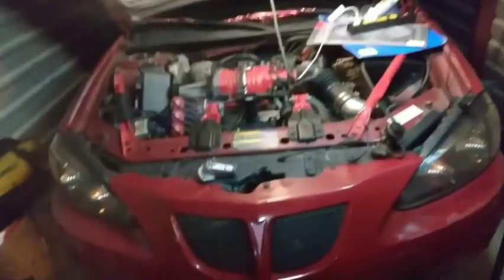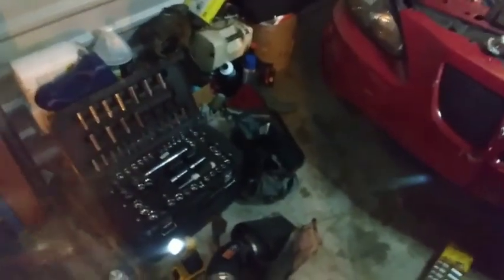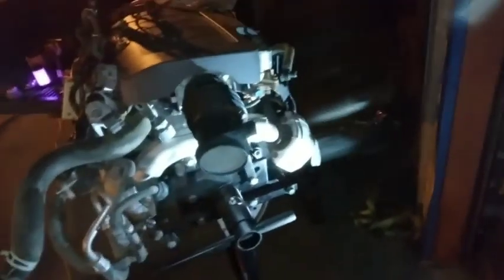So I need to get both the engines out pretty much, because these two heads are series 2 heads, and so they have a little bit smaller valves than the series 3 heads, but I've already put new valve seals and everything in them, so those are going to go on the Grand Am. And also in the black 06, it has the ARP head studs because I used them on that engine instead of this one. So whenever this one goes back together, it's going to get the ARP head studs with the cam and the double roller and the LS7 lifters. Everything that's in this is going to go into an engine exactly like this, but it's going to get stripped down. And that's what I was going to do, but